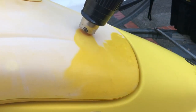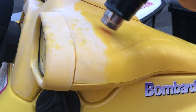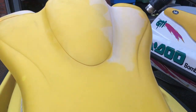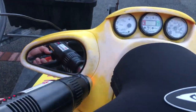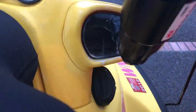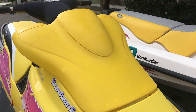How I restore this dash is to just not stay in one place too long with my heat gun. I take the heat gun and just work it all around, and eventually it'll all look like this. I want to clean it off first though, so I don't bake any of the dirt on there. The only thing you really need to worry about is leaving it in one spot too long and maybe singeing it a little bit, so just try and avoid that. To keep this amazing finish, I use Nappa Protectant — I just spray it on, let it sit for a couple minutes, then wipe it off.